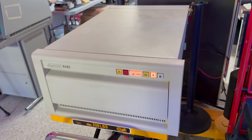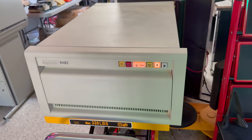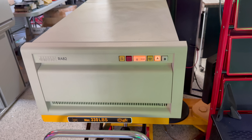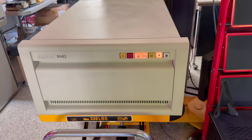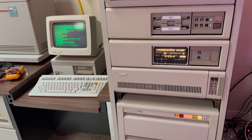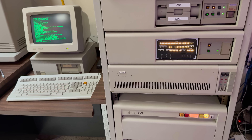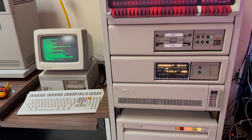DEC designed the RA82 with a kind of industrial elegance. A front panel with exactly the switches you need and no more. On the operator control panel you get run, stop, a fault, a ready light, write protect, and then two port select buttons A and B for dual port configurations. The ready lamp isn't just blinking lights cosplay - it actually tells you when the drive is on cylinder and capable of handling host requests, while the run lamp reflects the actual spindle state. That numbered ready lens doubles as the unit address plug. You actually set the drive number by trimming tiny binary tabs off the back of the cap and plugging it back in to present that code to the cam-coded switch behind the lens. It's like old-school DIP switch energy with a DEC flourish.